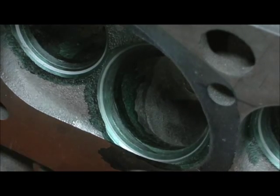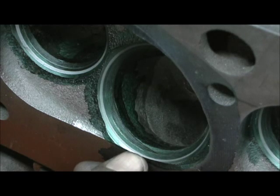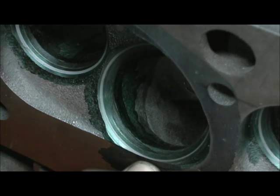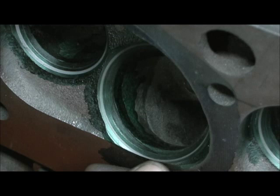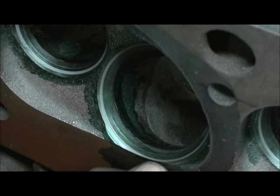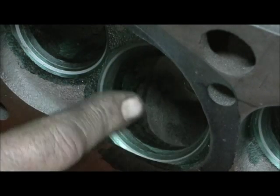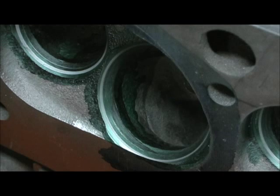The reason why — there are two reasons why most — wow, look at that 45-degree seat. Y'all see what I'm looking at? That's right there with the deck surface of the head. I got just a touch of a 30 before the deck surface eats it. That's how big that 2300 valve just eats that port up.